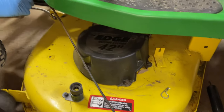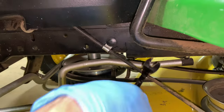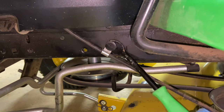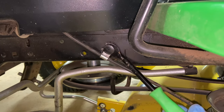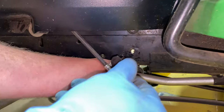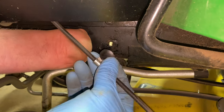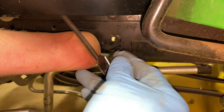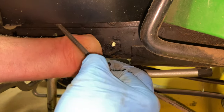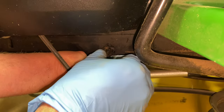You follow this around here and it attaches to the frame. This one is just a plastic clip fastener right here. We're going to use this tool — it's exactly what this is designed for. Just pry behind it, and I'm not going to try to break it because I want to reuse it. These have little barbs in the back, and this one looks pretty good, so we should be able to use it again.